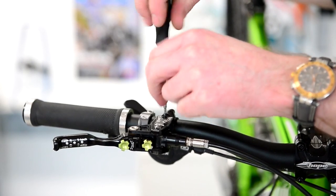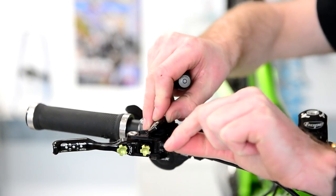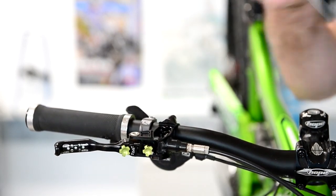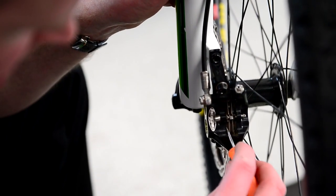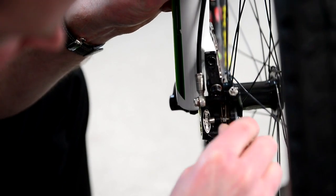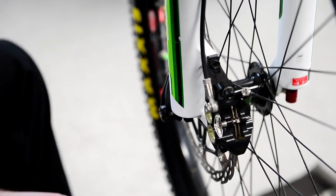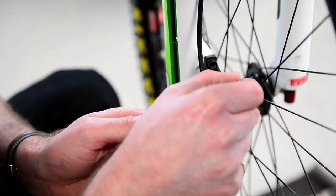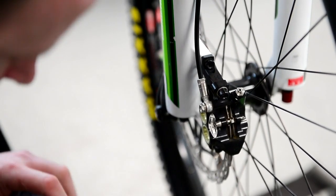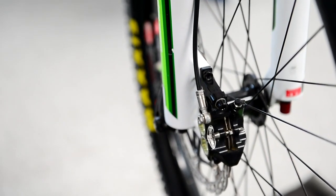Sometimes you can find that your oil level has gone down slightly. So we're now removing the cap to do the final finishing procedure of filling the cap and rolling the diaphragm in properly. Just make sure that you don't drip any oil anywhere — be very careful as it can ruin paintwork. Push all the pistons back using a screwdriver, pressing between the piston and the back plate of the pad. Don't use a screwdriver between the pads as it can damage the surface. Be careful not to chip the edge of the pistons as they are only phenolic and can be quite soft. Then take a tissue to soak away excess oil from the bleed nipple, as it can dribble out later and contaminate your pads.